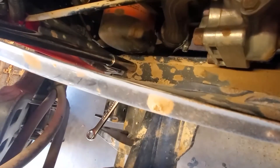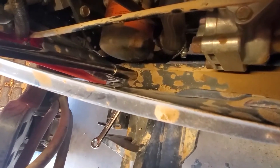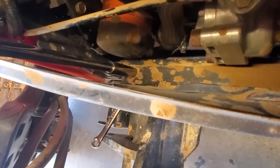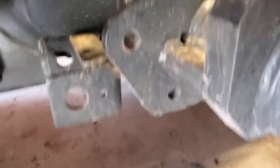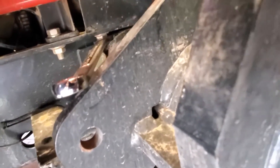The crazy thing with this, and I think it has a lot to do with the quality of the engineering, is that the back bolt is a 12 millimeter. Why 12 millimeter? I don't know. Most vehicles that come into the U.S. are set up so their sizes are near standard — something close to a half inch would be a 13 millimeter — but they've set it up with a 12. I'm showing you this because this is the easiest way to get in and out of this particular bolt. I use a giant extension on a wrench so I can get it above the arm, and then I back up the nut which is behind the mount for the bucket where the bucket attaches on. There's a big bracket right here and there's a nut right behind it. It's a 12 millimeter, both sides.